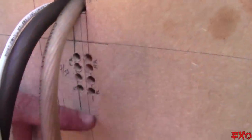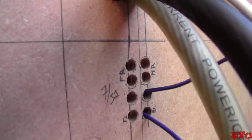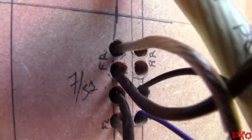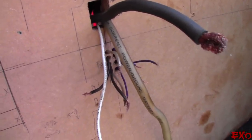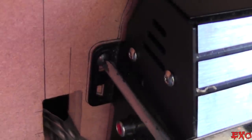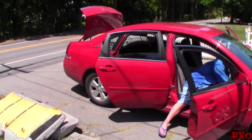So to you, all the right-hand speakers are on the left-hand side and all the left-hand speakers are on the right-hand side. We need the rear left on your bottom left. And then the front left is directly to your right of it. And the last one is the rear right. There's all the wires — power, ground, remote, rear left and right, and front left and right. It's amazing how much easier doing installs is when you have two people. Everyone who comes into my driveway ends up with their car in pieces.